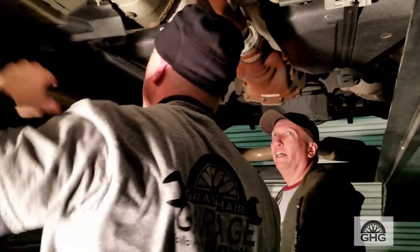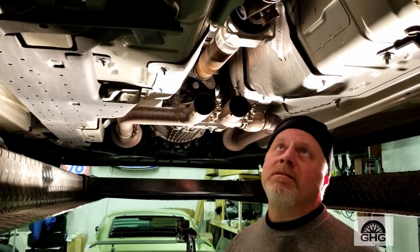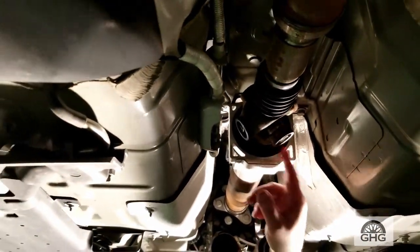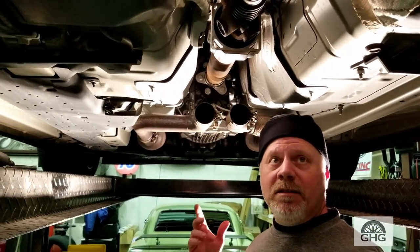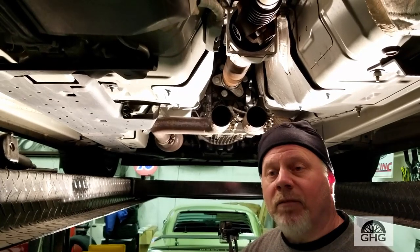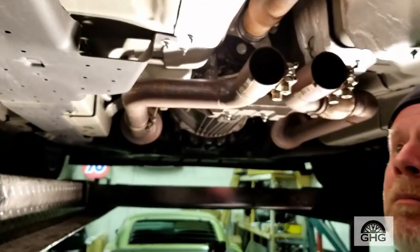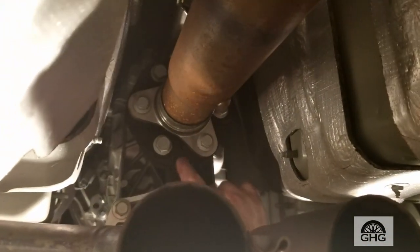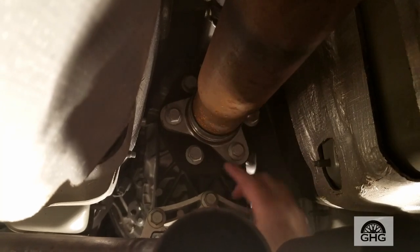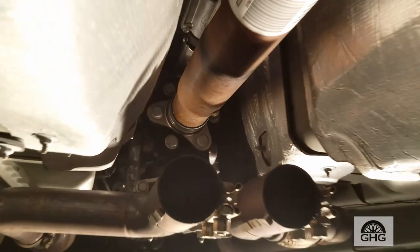This is the piece of junk I think Ford should have left out — they should have put a one-piece driveshaft. The reason being is this little joker right here is a non-serviceable part. You can't even buy this part. So if you want to fix the driveshaft, you've got two options: either buy an OEM one that's going to do it again, or go to the aftermarket. I bought a Shaft Masters one-piece driveshaft. One thing I like about it is it doesn't have an adapter for the transmission side. All the other ones do, and to me that's a complete waste. You see this little rubber donut-looking deal — there are six bolts total, three on the driveshaft and three to go to the flange of the transmission. That's a piece of junk too. My '70 had a full bolt flange like they used to have in the old days.